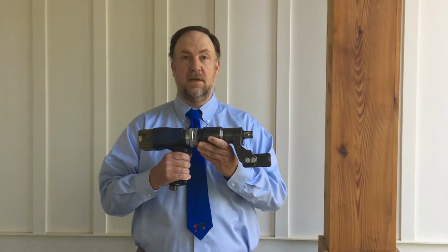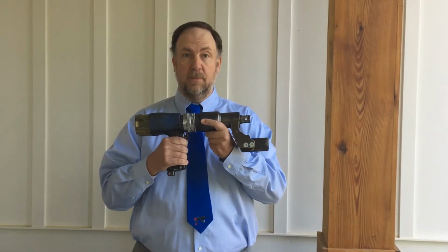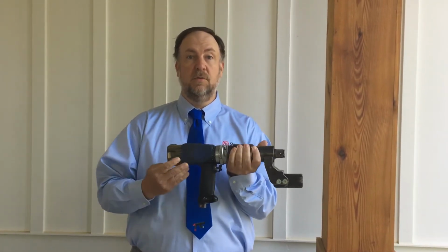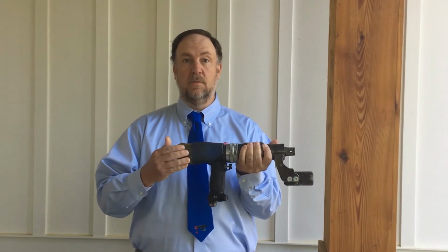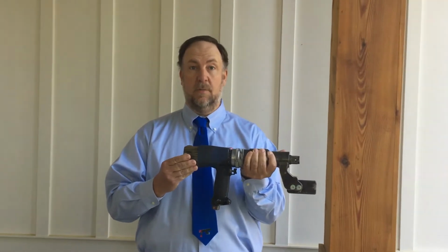Speaking of favorites, I'd like to share with you this morning my favorite tool in our lineup, the CP7600 Series BlueTork. This tool is OE torquing capabilities brought to you in the aftermarket garage. This tool features two rundown air motors. One's a 100 RPM motor, and then the final torquing motor is a 10 RPM motor.